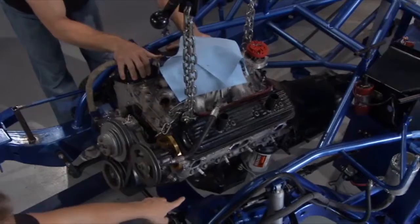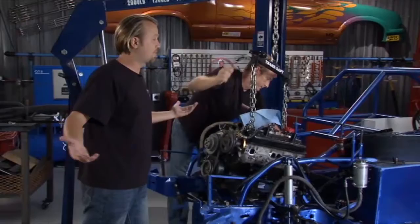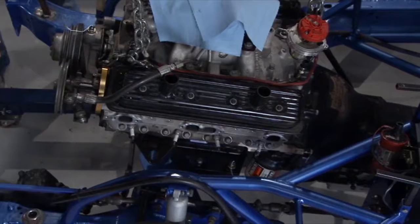The mounts are right there and we're going to mount this directly to the chassis. On a typical street vehicle, you'd have some bushings in there to soak up vibrations and make the ride more comfortable. Well, comfort is not really any concern of ours with this particular race truck. We want a good strong connection. It might vibrate a little bit, but when we're revving it up it's not going to roll from side to side. It's all going to stay together as one good tight package.